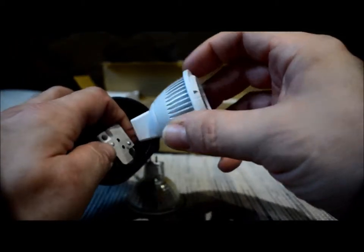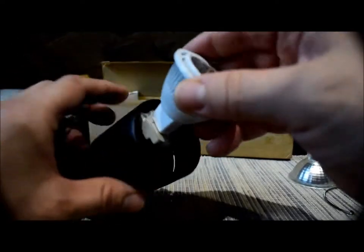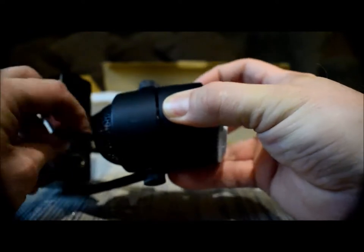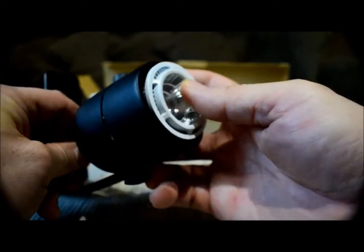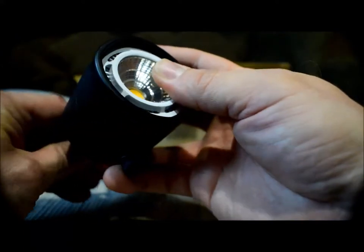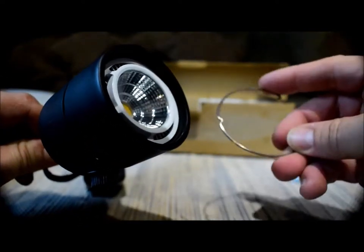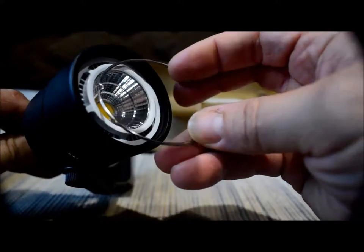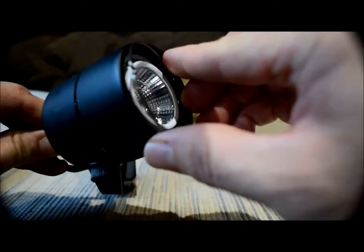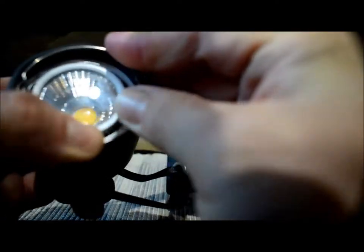You're going to take this wire and push it through, then pull it out. You're going to want to grab hold of the porcelain clip and the plug and wiggle the bulb — it should pop out just like that. Insert the new LED, discard the old bulb, push the cable back through and pull it in. Make sure it pops in there, then take the old clip and insert it — you need two hands on this. There goes one, two — now it's engaged.